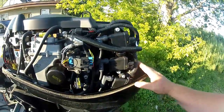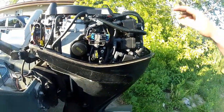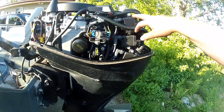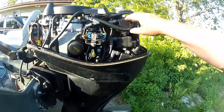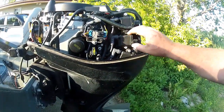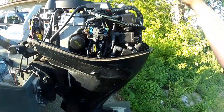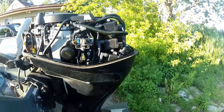I said I want to confirm this — I don't want to play around. So I took the number one and number two coils off and swapped them: number two up to the number one position and number one down to number two. Started it up, and now my top cylinder was the one not running. Right then and there I knew — it's the coil.